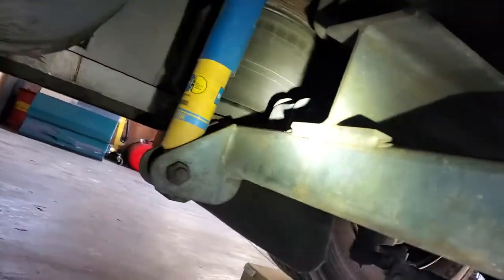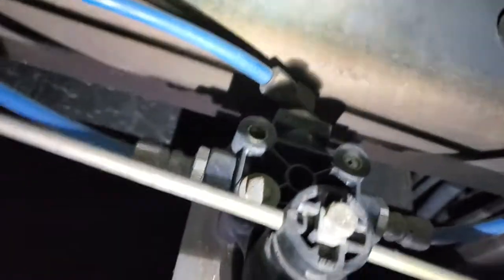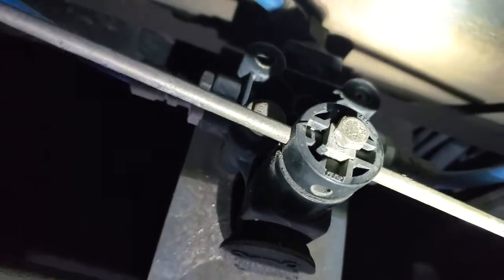You can see how far the rubber is down. I'm going to twist this valve right here — that's the ride height valve. The top blue line feeds from the tanks, and each blue line feeds each two set of bags. Your driver and your passenger side — we don't say left or right.